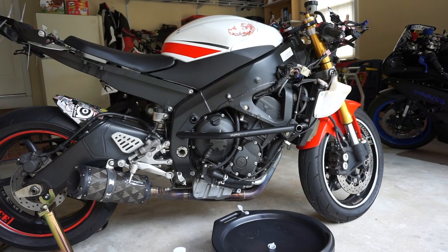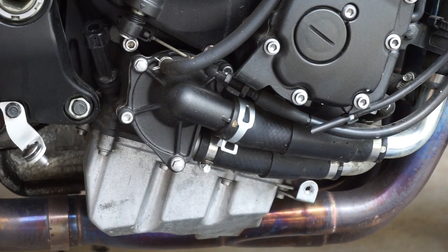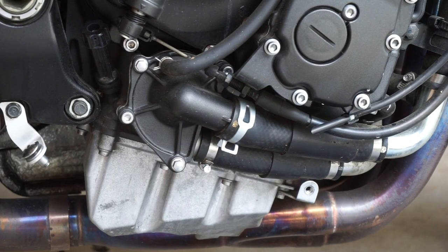First things first, we're going to need to take the nut off to allow the coolant to drain from the motorcycle. If you're watching this video you probably don't know where that is — let's zoom in — that little guy right there, that's the nut we need to take off. Grab the wrench, grab the 8mm tip, and let's get it off. Be careful, coolant will start coming out once you take this nut off, so you're going to need something underneath it to catch the coolant.